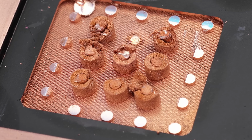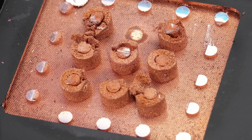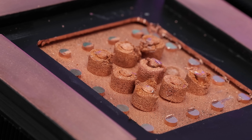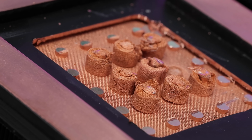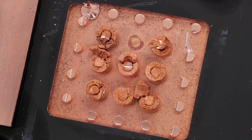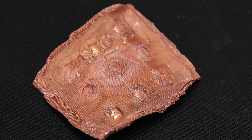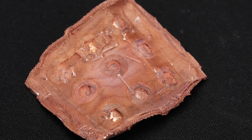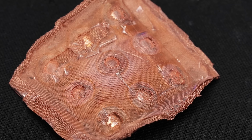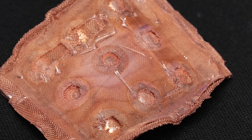In the GPU area we have those 9 additional rods with the copper sinter material that is for transfer of the water from one surface to the other surface. Due to the very fine structure, this allows, with capillary effect, for the water to travel from one surface to the other, and thus to vaporize on the GPU contact area. Again, also here there is nothing unusual I could spot. All the damages are expected from our special treatment. One more high resolution picture at the end, which is showing the backside of the GPU cold plate, showing the stacked mesh, the fine one and the rather rough one. And it also shows some of these areas where those support rods are connected with the sinter material.